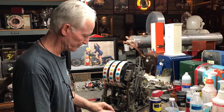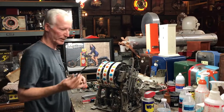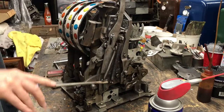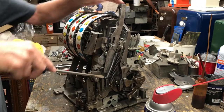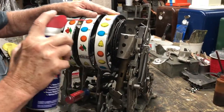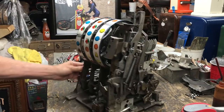The secret of what makes good slot mechanics is knowing what to bend — and sometimes that's it, I've fixed it, and that happens quite frequently. Now I'm going to take a plain old screwdriver and pull back the coin detector — this is what detects the coin up here. If I hold that back, the machine thinks there's a coin in there. As you can see, our reels are spinning very nicely.